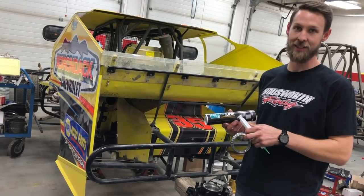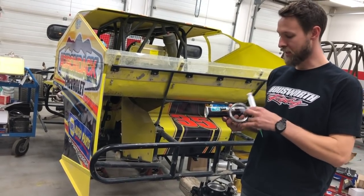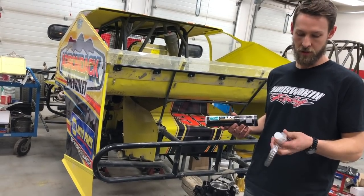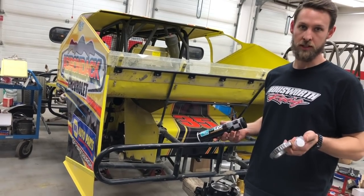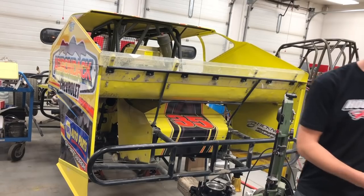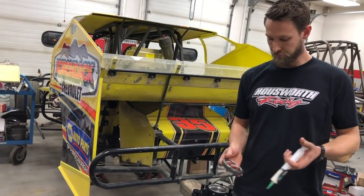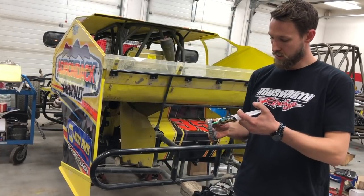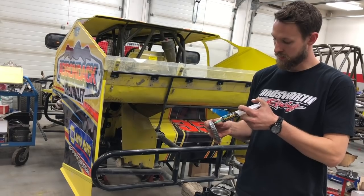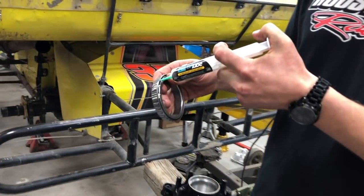So the next thing you want to do is grease the bearings. The best grease that I've found with the lowest drag would be Day Lube nano ceramic grease for racing purposes. You can get this at Precision Hydraulic and Oil. The best way to apply it is with a syringe — just squeeze a little bit of grease in every other roller from the backside.